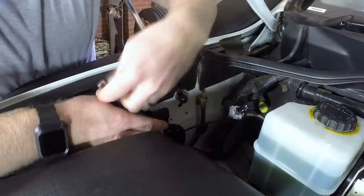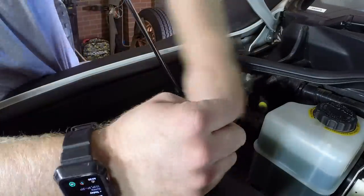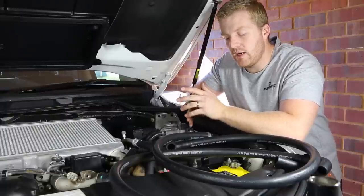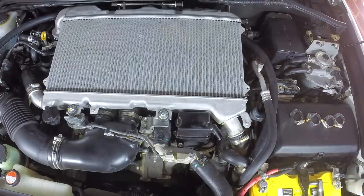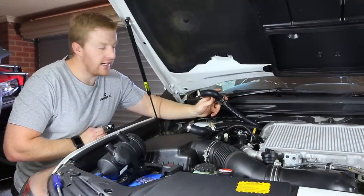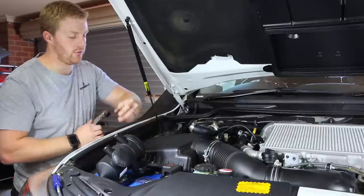One thing I noted from the Western Filters kit was just how well everything fitted to the vehicle. The bracket fitted perfectly first go — it even has a cutaway for the lower end of the gas strut that lifts the bonnet. The hoses were the perfect length and the unit fit very nicely in that area. The bracket for the ProVent is now installed. I'm going to skip installing the can onto the bracket just yet because it'll be very tight to get the hose connections on once it's installed. I'll run the hoses from the crankcase ventilation system and the air intake hose behind the coolant reservoir and over to that corner, then get it all plumbed in and fitted to the bracket.